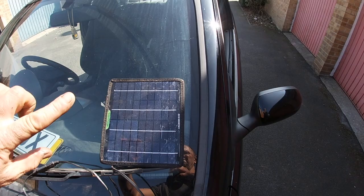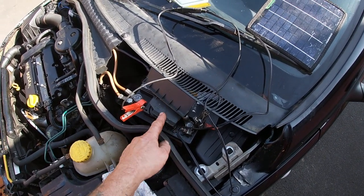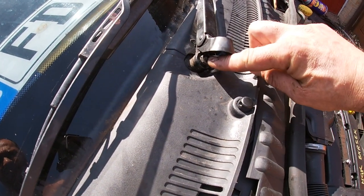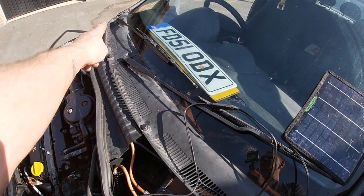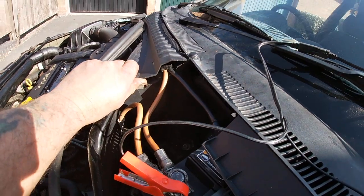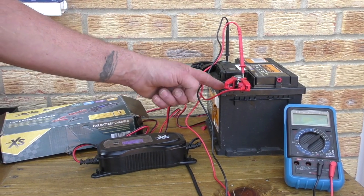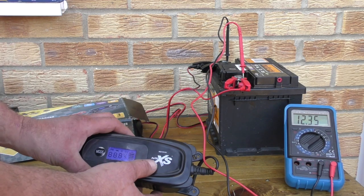This is relevant to mum's car — I'll show you the battery. I've got it on charge, solar powered, but it is a pain to get out because you've got to remove all these panels and take the wiper arms off. Even though it's a fairly new battery, I had to struggle getting these off — they were seized in place. The whole lot lifts off and it's all plastic, and it is necessary because it's also a rain guard. I can see the battery cables underneath there which run across the front, giving potential to run a bit more power later on.